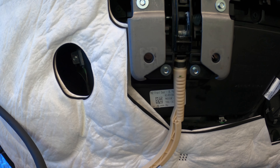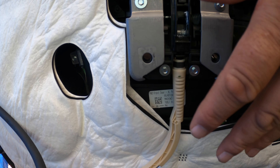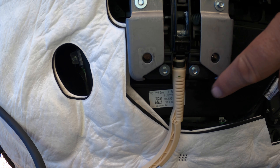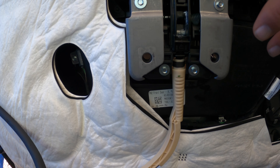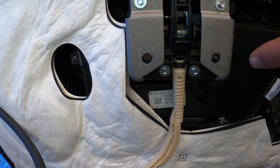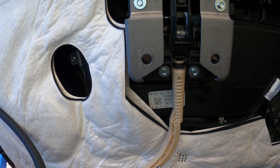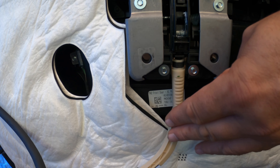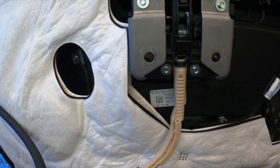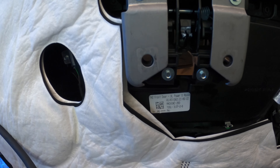With the actual lock knob there are two tabs — push both in, pull down. I did have to look up how to remove this cable from the door handle. Unfortunately every video I saw goes through all the steps until it gets to this part and not one person removes this. Some videos don't talk about it at all, some say there's no reason to remove it — but if you want it to be more convenient when working on your speakers, window, or whatever, it's easier to take this off completely. In one video the guy said this part becomes very complicated, so here is what is so complicated about it: there's a little tab right here — push down, lift up and lift out. There you go — door panel can now be completely removed.